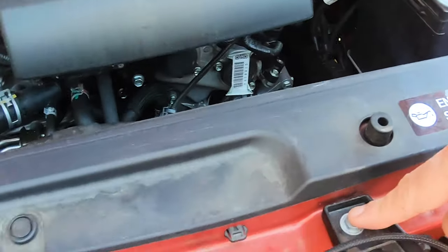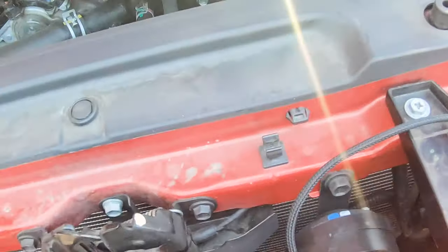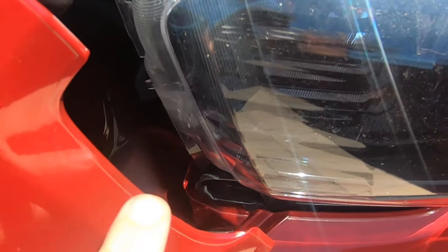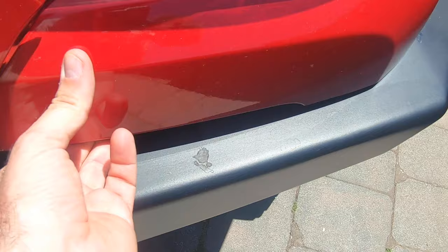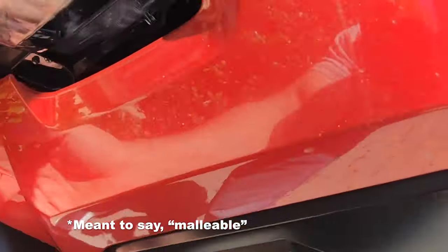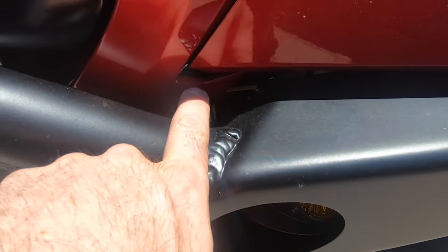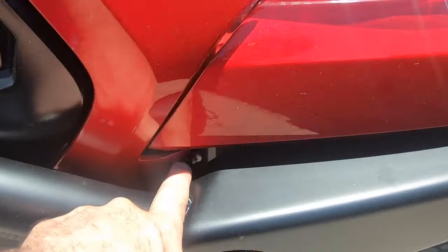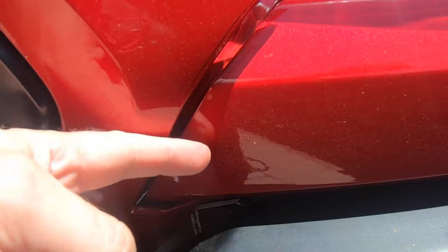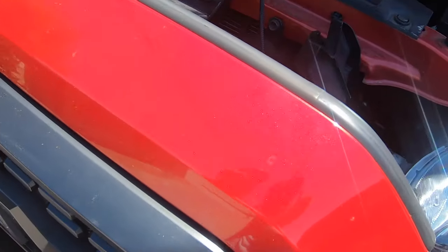First step is take off these two bolts here with a 10 mil. And then there's some clips right there and actually probably a little further in that we have to undo, and then this thing will start getting loose. Pretty simple to do. One thing that you can optionally do — like right in there on both sides, there's a clip right there that I recommend you undo, which is actually more for this part of the fairing, because that allows this to be a little bit more manipulative. Same here. So that way, as you pull out the rest of this, it doesn't get caught by this little lip as much. You got to take your time and make sure to work it gently so you don't damage anything. The challenge is to get this little claw over this section, and this bull bar here is limiting the ability to move forward. So it's a little bit of a pain, but just take your time, don't freak out — it'll happen.